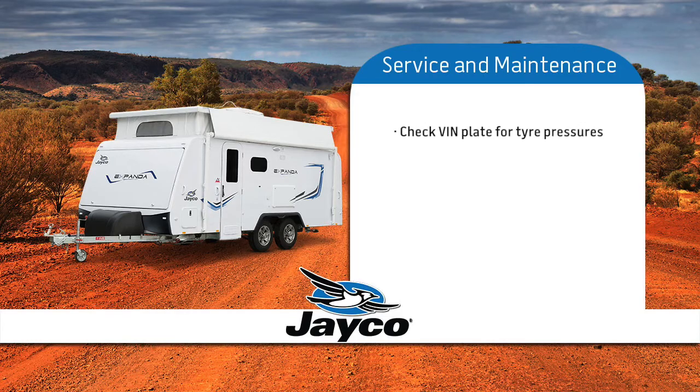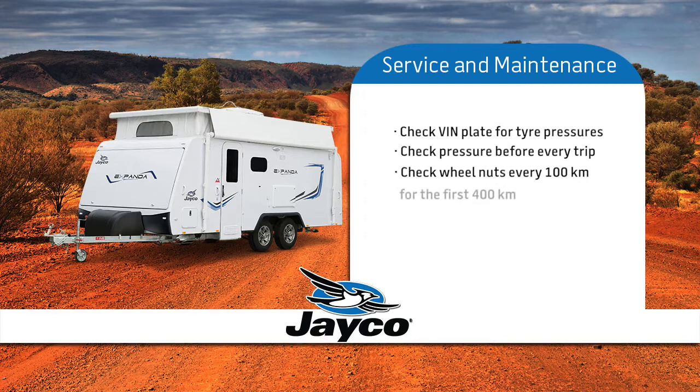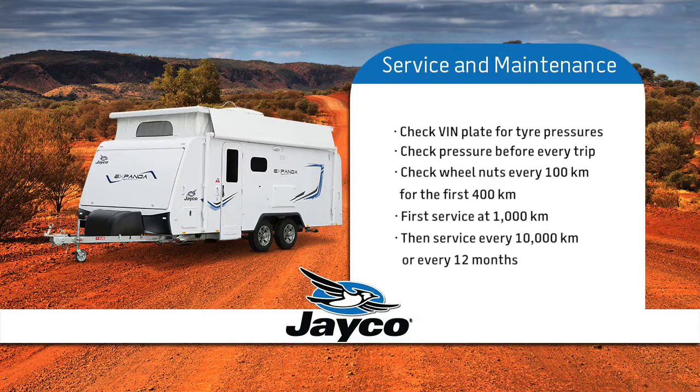Check the VIN plate for correct tyre pressures. Be sure to check before every trip. Remember to check your wheel nuts every 100 k's for the first 400 kilometres. Your first service is at 1,000 kilometres and every other service after 10,000 kilometres or every 12 months.